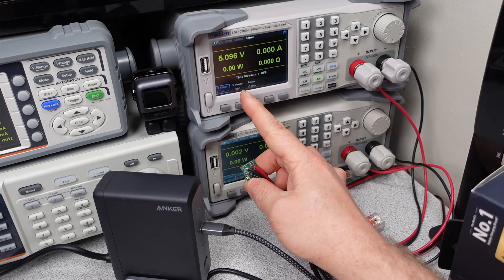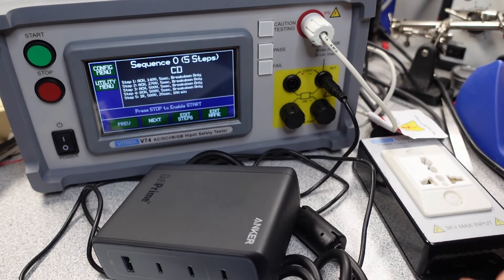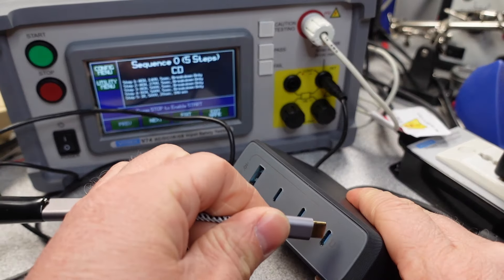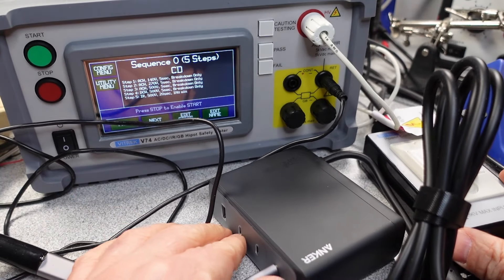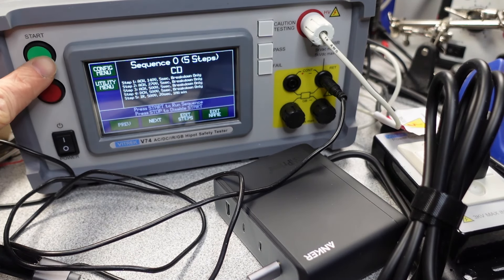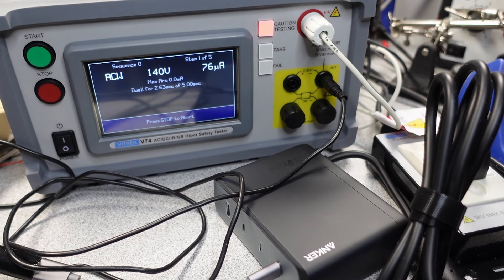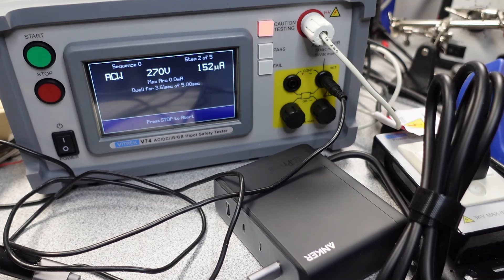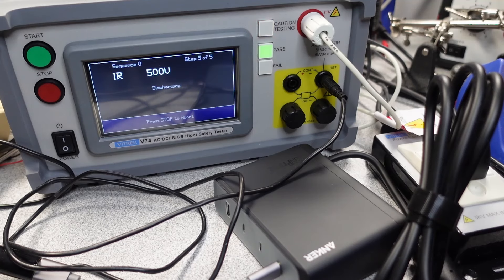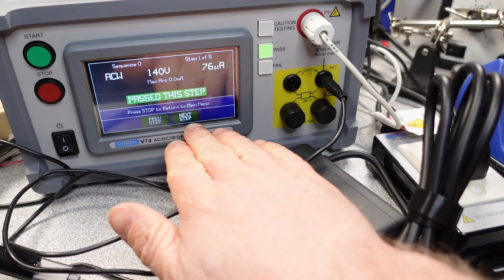No earth bonding to worry about, but what about leakage current? This is the electricity that leaks through the unit and gives you that tingling feeling while working on your laptop. The isolation performance of this product is excellent. The data I could find for dry skin and perceptible current is one milliamp. Depending on the wetness of skin, this could be much lower. I think this needs to be updated desperately because I can detect 250 microamps pretty easily. The measured leakage current of this Anker 240W adapter was a mere 153 microamps at 270 volts RMS, which is very impressive. This means you should be tingle free using this product anywhere in the world. It doesn't meet medical grade requirements, and it doesn't claim to. For context, Baseus and Satechi are bad choices for 240 volts — they don't meet the 250 microamp threshold. Fine on 120 volts, but bad above that.